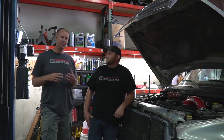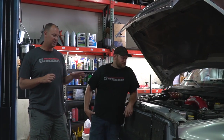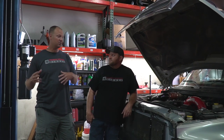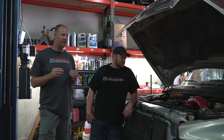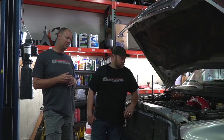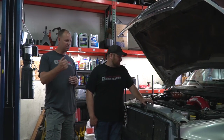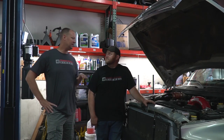We are now back at the shop. We did the towing test yesterday and it towed very well, but the low end smoke was a real mess. We came back and tuned out a bunch of low end smoke — with the Quadzilla Adrenaline you can do that, other tuners you can't. It still has the 7x12 injectors with a little pump at the bottom. We took out so much that it had a dead pedal, so we put a little bit back in. There's still an idle haze at altitude — what you'd expect with big injectors, especially when you put it in drive at a stop sign. Now we're going to get on the dyno and see what this thing can actually do.